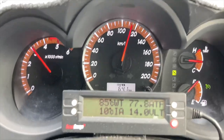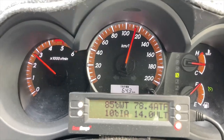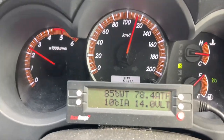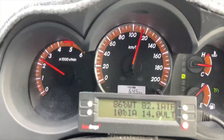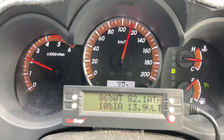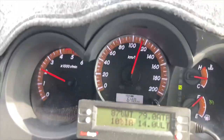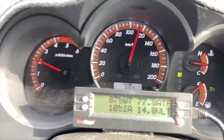Let's see how long it takes to lock up again. We're back into top gear, unlocked, fourth, slipping at the top of the hill. We've got a downhill. This is where it's better if you come off cruise control in these vehicles. Now it's gone locked — beautiful. You'll see the temp start dropping rapidly initially until it gets back down to the genuine pan temp.